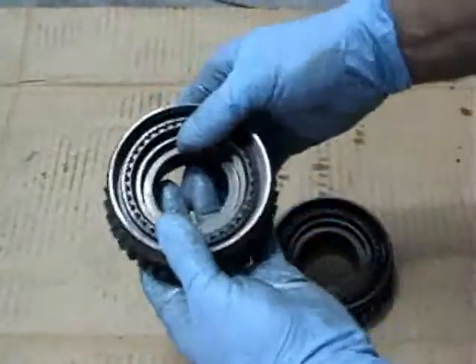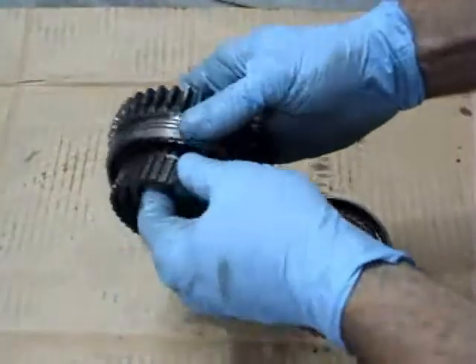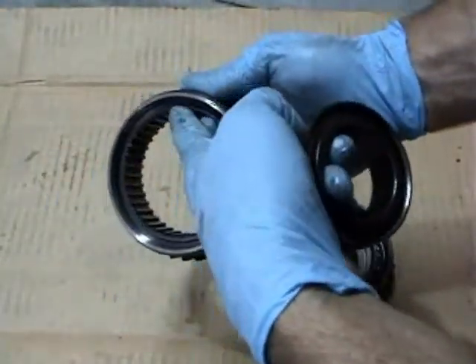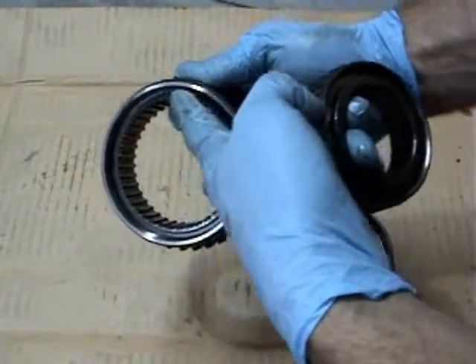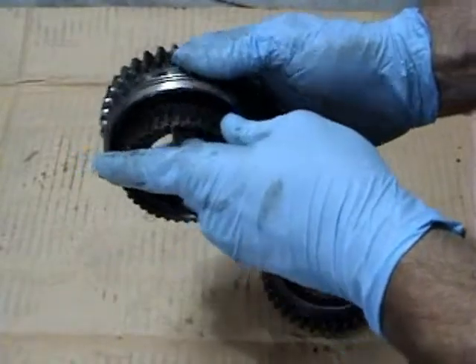That's it. That's why one-two gets messed up — missing gears. What happens is when this swings forward and actually engages the collar on the gear, it gets smeared. So then it wedges, being that the factory tolerances are so tight.